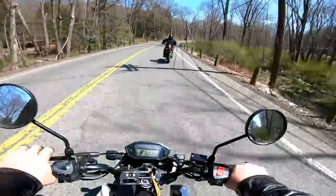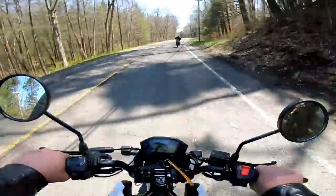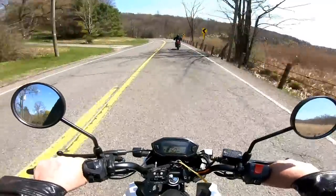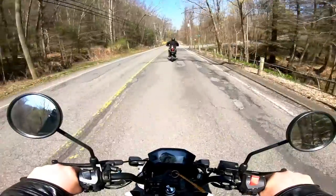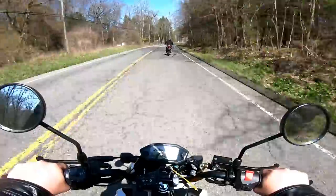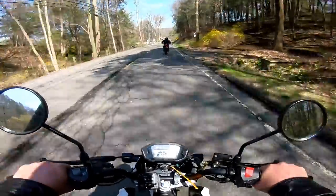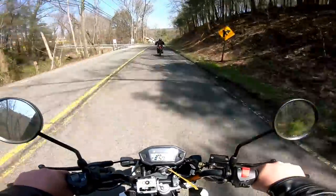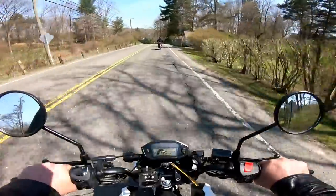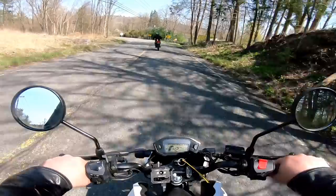Haven't ridden with a blade on a TBR7 in a while. I was gonna wear my gloves, and then I didn't bring my gloves. Of course. So the TBR7's running good for him. Been a really good bike. The Magician, when he had it, he had a lot of issues. I think most of it was because we didn't gear it up and he was revving out a lot and it would vibrate a bunch of stuff off. If you plan on riding these on a road, you definitely want to up the sprocket to a 17 on the front, maybe even go down a few teeth on the back.